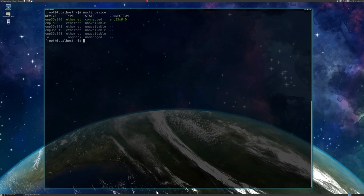At least, I haven't plugged it in, so let me show you something here. I'll grep for Atlantic, and you'll see that the driver renamed the interface from eth0 to enp1s0, which is this interface, which is not currently plugged in. I'm actually curious to see what happens if I unplug the cable from the Intel NIC and plug it into the onboard NIC right now. So that's what I'm going to try to do.